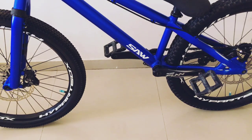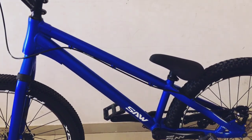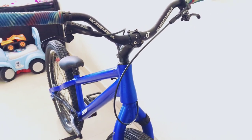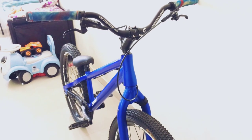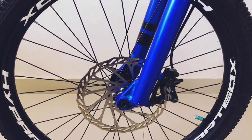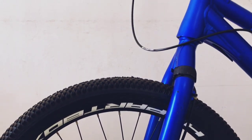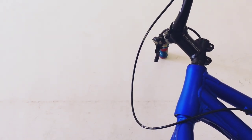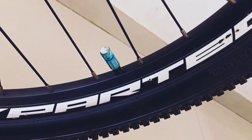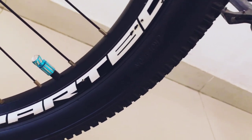This bike is made especially for street trials riding, so it's very lightweight and very strong. The weight of it is only 10 kg. This is not the stock bike — I have upgraded many parts. The fork is also made from 6061 aluminium, so it's very lightweight. I also have a strong wheel set here — the rim is a 24 inch Hyper D Box double wall rim, 38mm width, very strong.